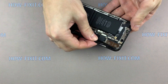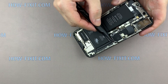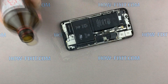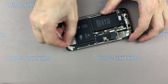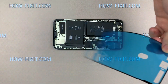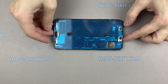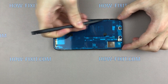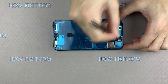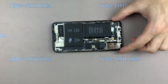Remove old glue from the iPhone case. Using medical alcohol, wipe the iPhone X case to remove the old adhesive tape. If you want to restore the water resistance of your iPhone X, you need adhesive tape like this. You can assemble the iPhone X without it, but this makes no sense because the adhesive tape costs only a couple of dollars. In the description under the video you will find a link where you can buy this adhesive tape.